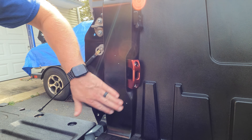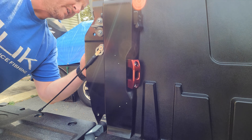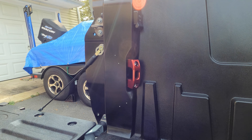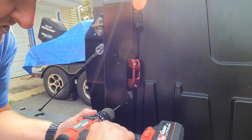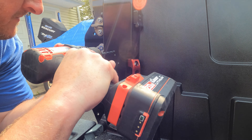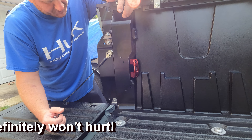Put the drill in forward and we'll go straight through. You want to try not to go farther than an inch in there, so I'm going to put the bit deeper in the drill to stop it from going too far. On the other side it's completely empty, but that's what the instructions say. Once your pilot holes are drilled, switch over to your 17/64 inch bit and go through all four. Once you have these four holes drilled, I'd recommend adding a little bit of primer and paint inside the holes just so you don't have any trouble over the years with rusting.